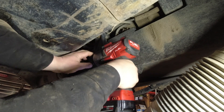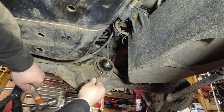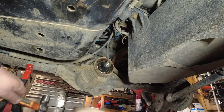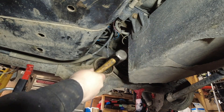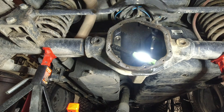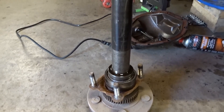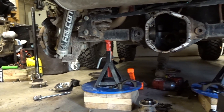Once you've buzzed the nut off with an impact, use a gear puller to pull the flange off — that's the easiest way. Get rid of the old seal because you'll be putting a new one on. Then I put the nut back on the pinion and tapped it through with a hammer, reaching through the other side to pull it out. The pinion bearing race comes out two ways: one gets punched from front to back, and the other from back to front. I used an air chisel to knock that one out. And as you can see, the whole rear end is disassembled. If you have any questions or comments, post them below — see you in the next video.